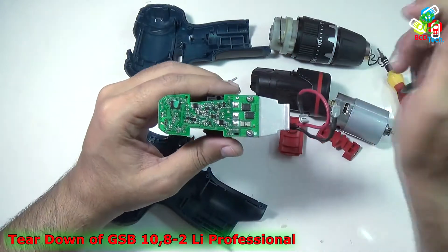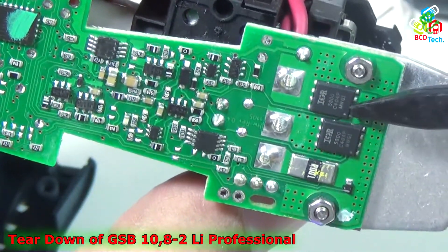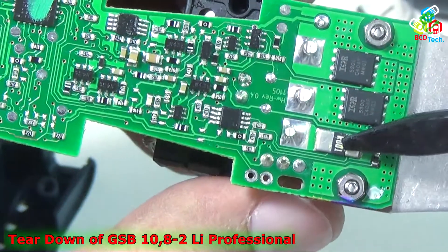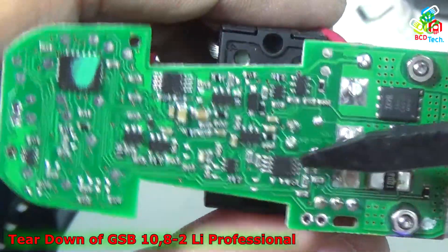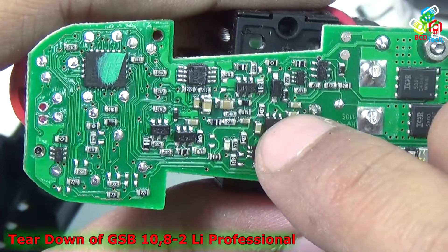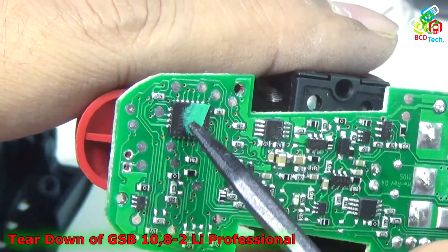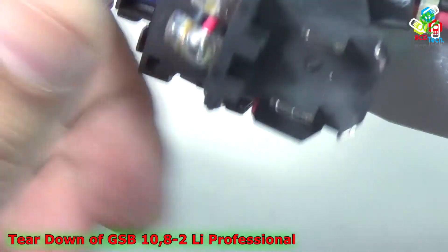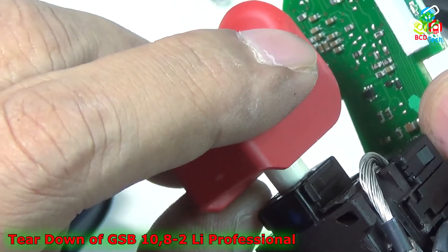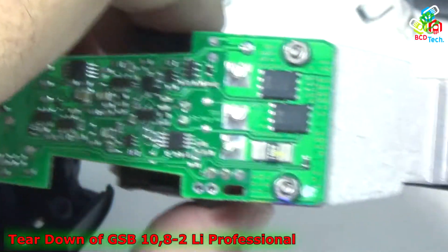Before the reassembly, I will show you the components on the motherboard. The IC number is IOR 5300C404PMWG1, and there are 2 of those. There is a very large resistor, that is R001. Some of the IC serial numbers are not visible. There are some MOSFETs, and on the bottom of this PCB there are resistors and capacitors with certain MOSFETs and ICs. There are also 3 LEDs and a flash LED.